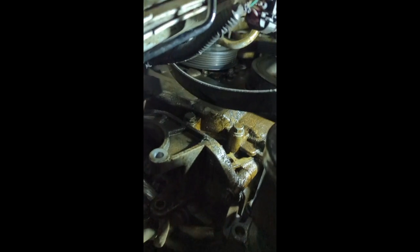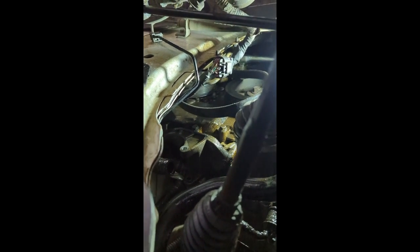I got to dip the pump out. Up in there you can see those two holes, that horseshoe. The upper bolt was really difficult to get out because GM put a wire harness right in front of it, so I had to have a real short setup. I was able to get the hose off — a little tip: take the clip off. When you take the high pressure hose off, take the clip off the low pressure as well; it made it a lot easier. When I took the pump out I had to go in behind this frame member and bring it out, turn it a couple of times and bring it out toward the transaxle by the exhaust pipe — it came out through there. It's very tight, so now I have to switch the pulleys over.